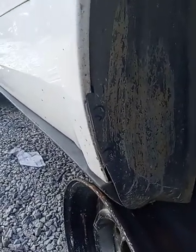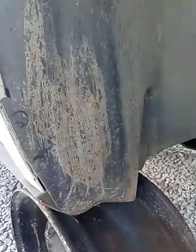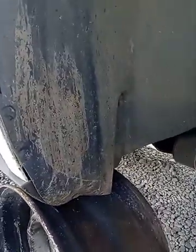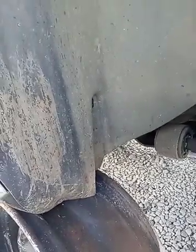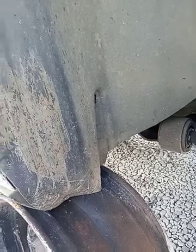Anyway, this is a Ford 500. I haven't seen too many videos on YouTube showing where the crankshaft position sensor is and all that. You know it's going to be located near the crank somewhere. I'm going to show you all — for those who don't know — you can actually remove this crank sensor on this car, on this 3.0 V6, without jacking the car up.